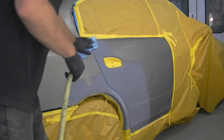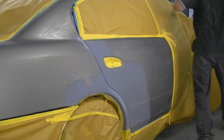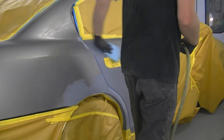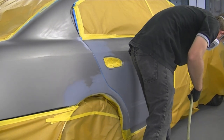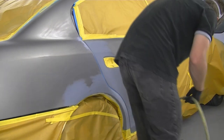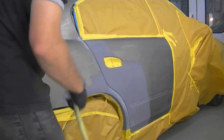What's up guys, Jimmo here again with Refinish Network. Today I'm going to be painting this Nissan, I believe it's a Sentra. I'll be blending the color within the door and the quarter. Right now I'm just washing it down with a tack rag — it's already been washed down with a degreaser and a water-based cleaner before this.